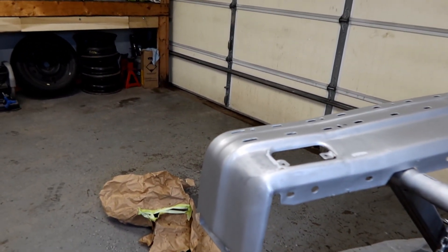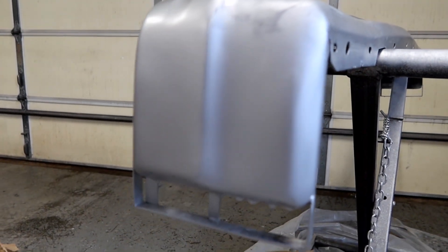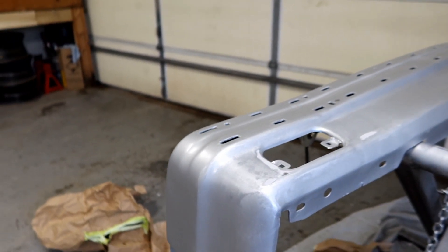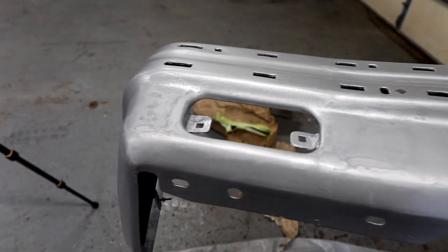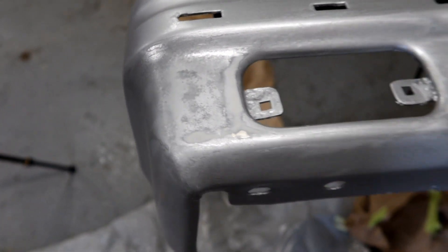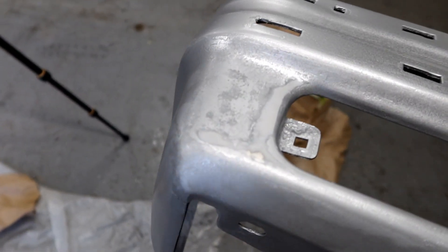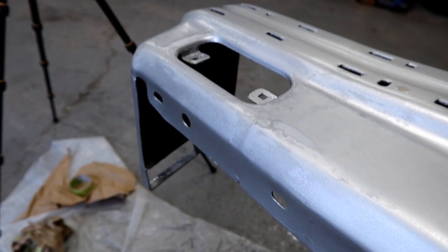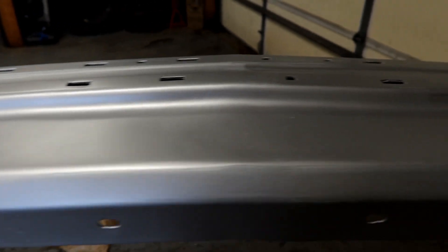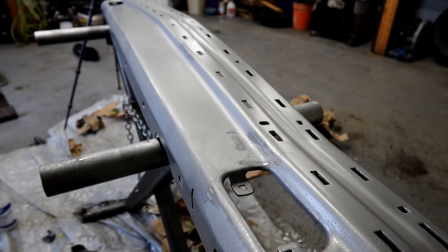Here's the unfortunate part — despite my best efforts, I did do a good job blending and getting rid of that line with the wet sanding, but I just had thin paint. And that was my problem — when the clear coat got too heavy, it made the thin paint bubble up. So then I tried to touch it up, and as you can see, we still uncovered those same issues. I'm so sick of painting and sanding and painting and sanding.